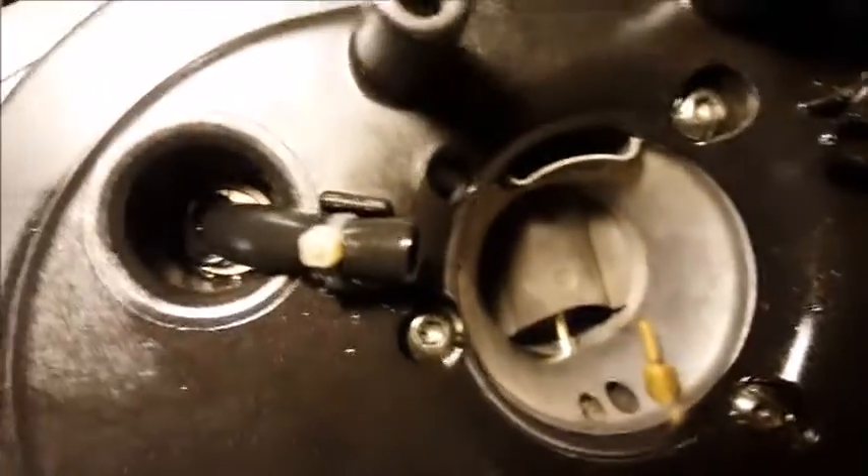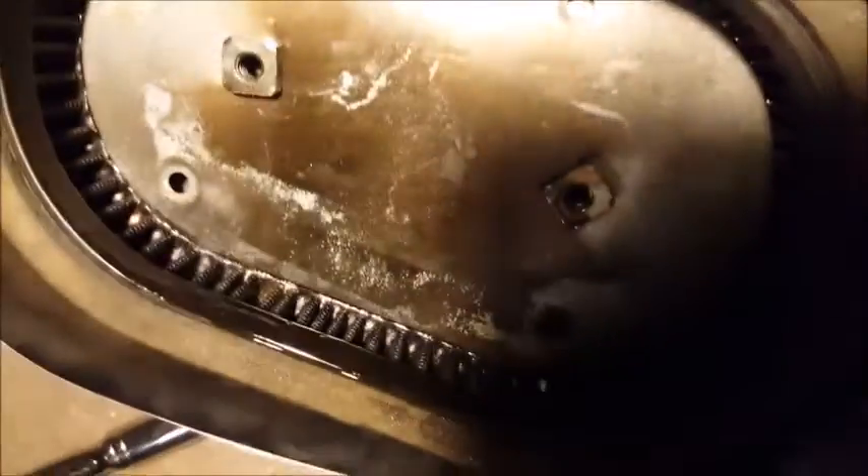This is what Harley has done since '91, and it's their prerogative but I don't prefer it. Now they don't breathe down through here — they breathe up here. Crankcase goes up into the heads and comes out through these little hoses, and you are sure to eventually get oil all up inside here and get the air filter just soaked with oil. Those bolts are supposed to bolt in there and just breathe freely without putting any oil into the air filter.